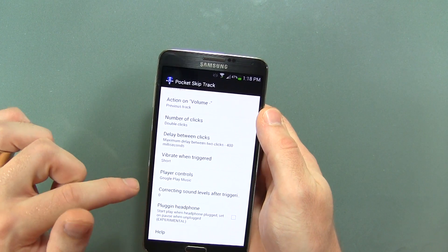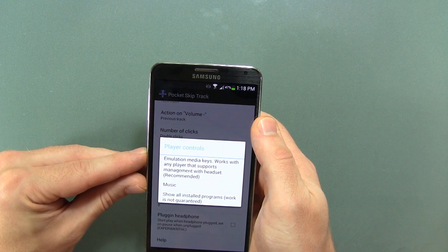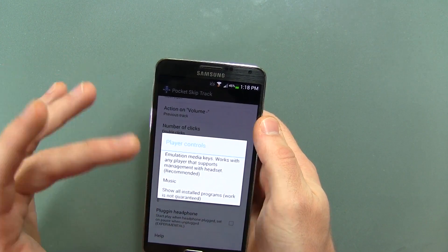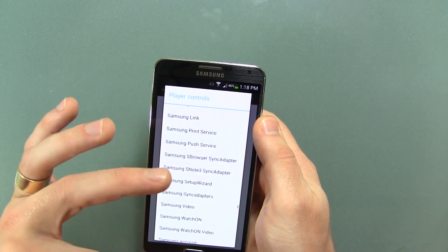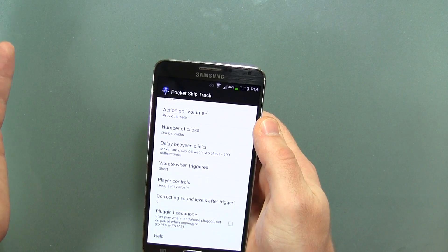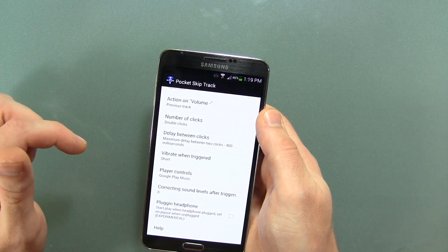The reason I wanted to leave this one to the end is because when I first started trying to use it, it was actually turning on the Samsung proprietary music application and I don't have any music stored locally, nor do I ever intend on it — it's all in the cloud on Google servers. So I found this setting — it says 'show all installed programs, working is not guaranteed' — the developer's first language is obviously not English. I clicked on that and it brings up all the different applications I have installed. I went down, found Google Play Music, clicked on it, and it immediately started working. So just in case your device doesn't pick up on whatever music player you're using right away, go into that particular settings option and find the application you want it to work with.